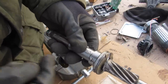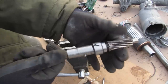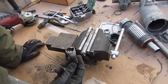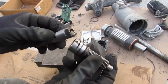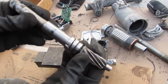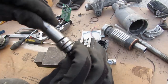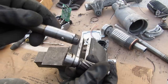I took off that ring and pressed this out — this ring just pops right off. The input shaft is supposed to pull out from the pinion shaft, but I can't get these pins to unlock, so I'm going to have to cut it. Essentially how this works: you've got your input shaft with two flat spots and two flat spots on the pinion side. When these two plug in it gives a hard mechanical connection, but there's a little bit of play. That play is taken up by the torsion beam on the inside, which twists ever so slightly, and that twist causes the relative motion between the output and the input, causing the torque sensor ring to slide up and down and register to the computer.